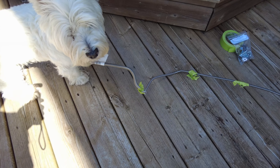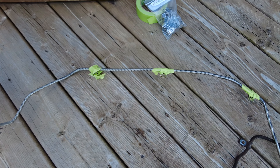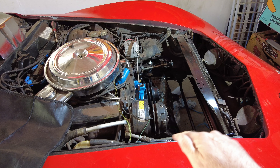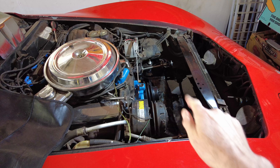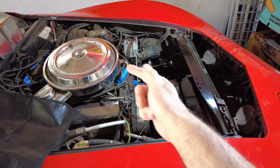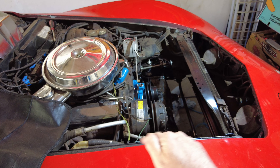So we've got the lines inspected and all the brackets in roughly the right position. Next step: putting it back in the Corvette. We're back at the Corvette and now I've got to put that big stainless steel brake line in here. First of all, I'm just going to loosely place it in and hopefully be able to feed the line through the channels that it needs to go through on that side, and then bolt it down.